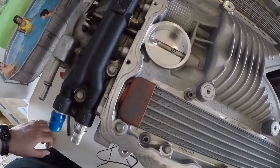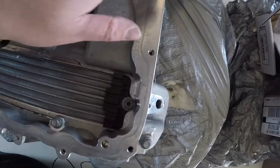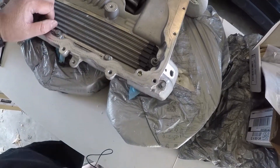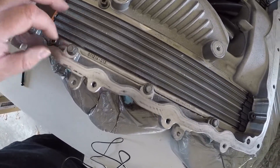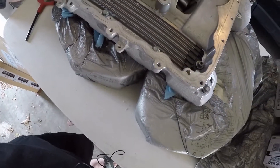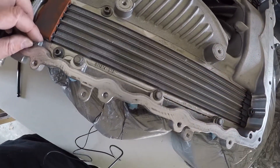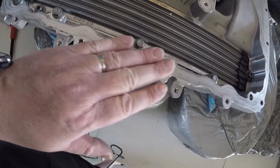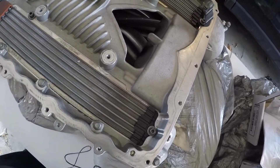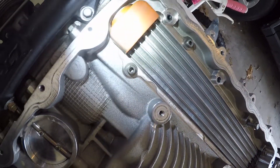The gasket surface looks pretty good. GM has very strong warnings about gasket surface cleaning — they strongly recommend not using blades or anything sharp, or even power tools. I have a gasket remover that goes on my air tools or drill for cleaning up bearings and such, but GM actually recommends not doing that on surfaces that deal with air, oil, and fuel, mainly because you can microscopically change the flatness of those surfaces and cause small leaks. Looking at this guy, I really don't see any nasty grooves or marks, which is good.